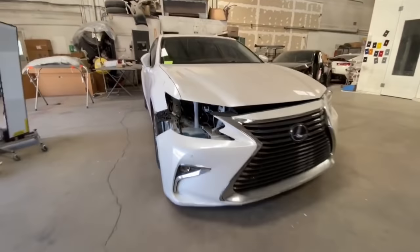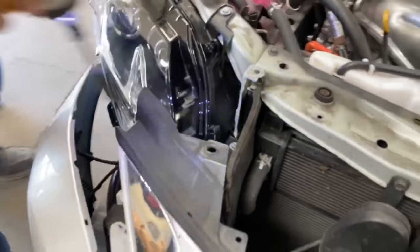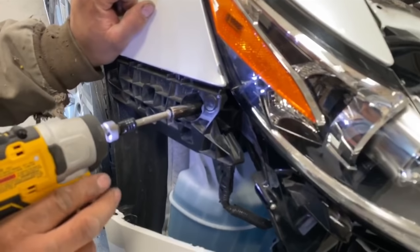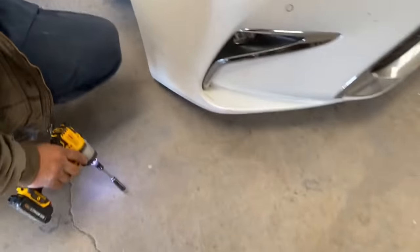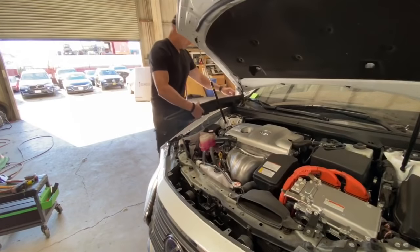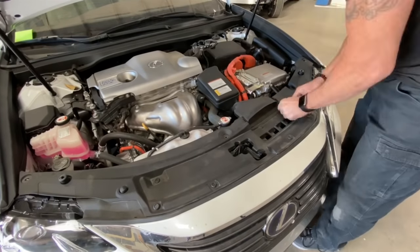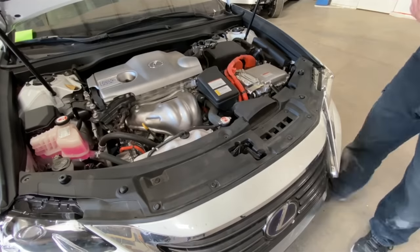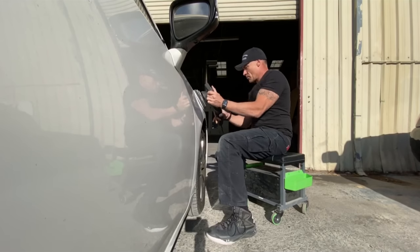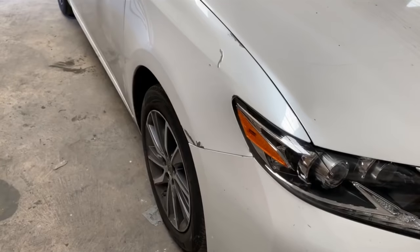Zooming out. Time to put the car back together using a common 10mm socket. I'm going to tighten up around the fender and around the headlight. Attaching the bumper to the upper bumper bracket. Putting back the engine compartment trim and locking the parts in with the vinyl clips. Closing the hood. Final step: clean up the clear coat with a polish and a buffer. Now I'm ready to show you the body work using the paintless dent repair method — let's check out the final results.